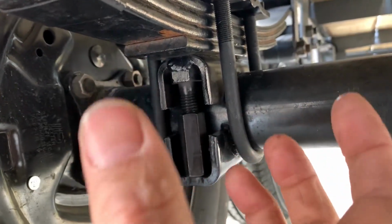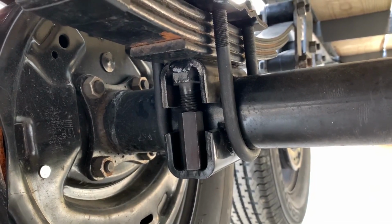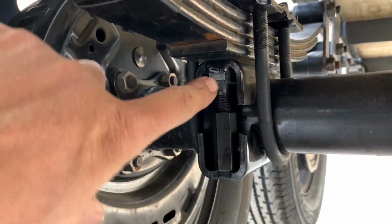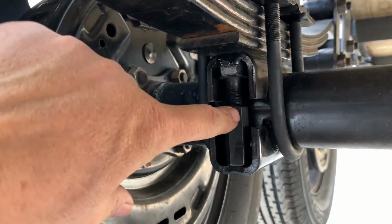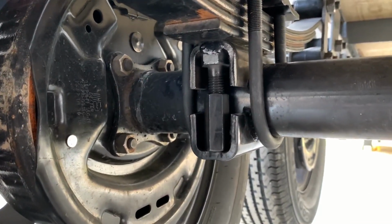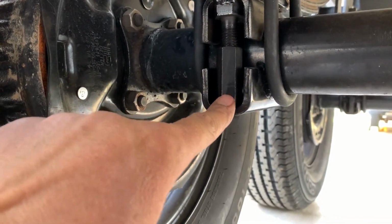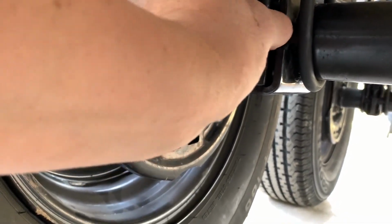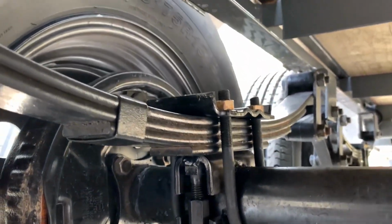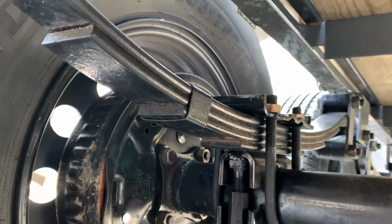The welds are just kind of holding it from maybe walking side to side, if that ever happened. But as far as it moving around, it takes all the load when you're braking, and it puts it down on this bottom one that is welded by Dexter, and it's all essentially one piece, and then this is just jammed up in there, and they don't move. So I checked all of them, they're tight, and I went about 100 miles on my last tow. Before the next trip, I'll retorque all the U-bolts and all the lug nuts.